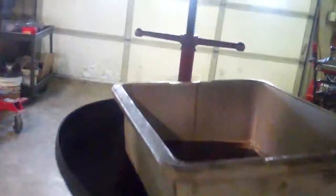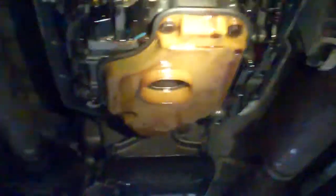We got the pan off your trooper here. You can see up in there, you can see the filter — everything inside looks pretty much normal, other than the fluid being really dark and having a pretty good burn smell to it. Also, when this came in, the drain plug was barely even in the hole.